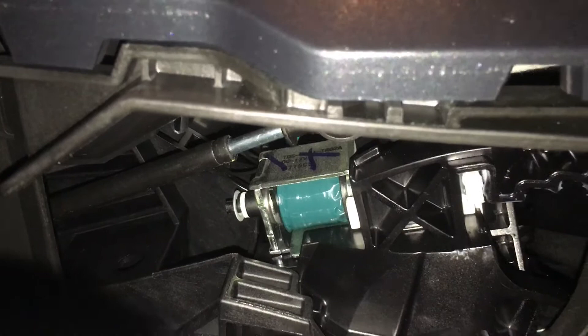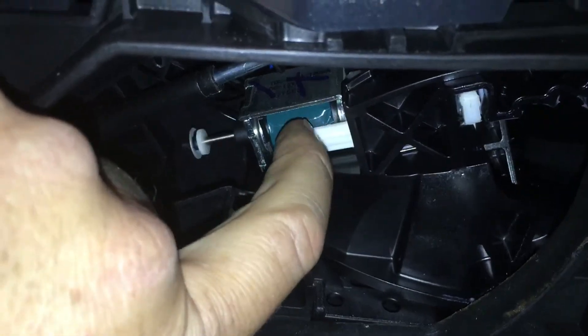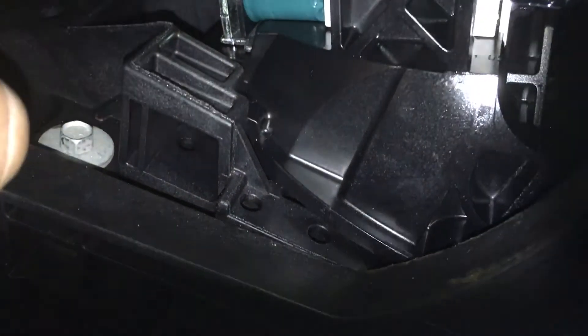Okay, so what I'm going to do is just turn the power off. Now I step on the brake pedal where it won't move, but I can get my finger in here and move that plunger — and then it'll shift. That's all there is to it.